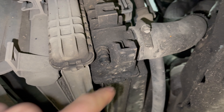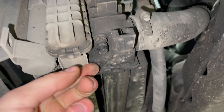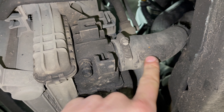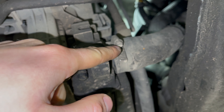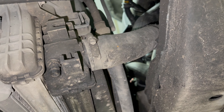You've now got two options. You can either use the drain screw here, which you can put a pipe onto and drain to wherever you like, or possibly a much easier option, in my opinion, is to loosen this jubilee clip here and remove the bottom hose.